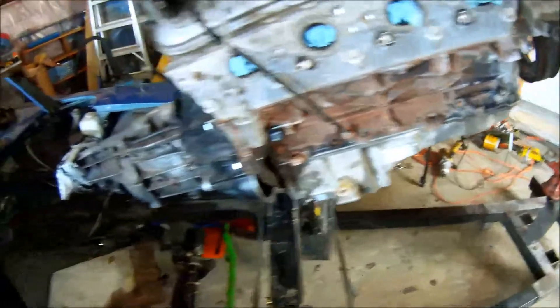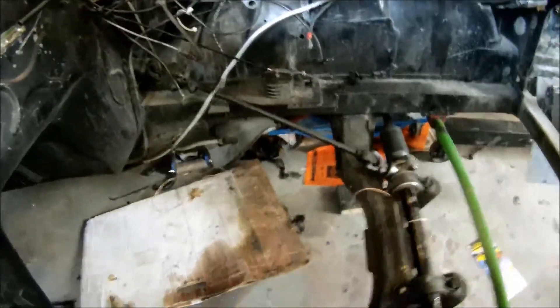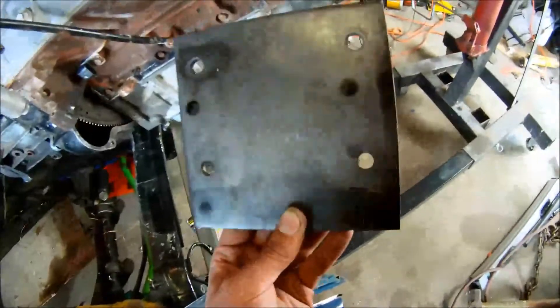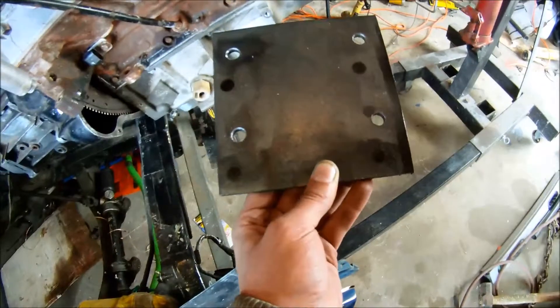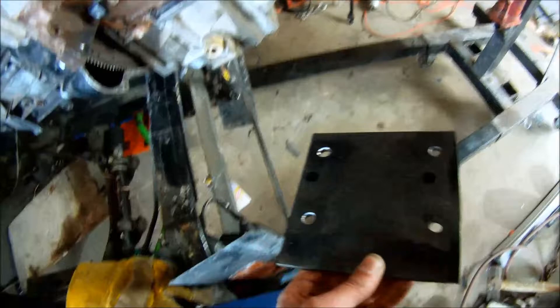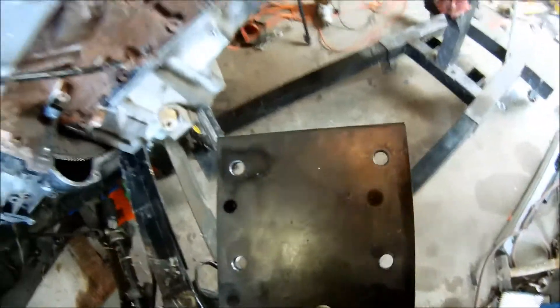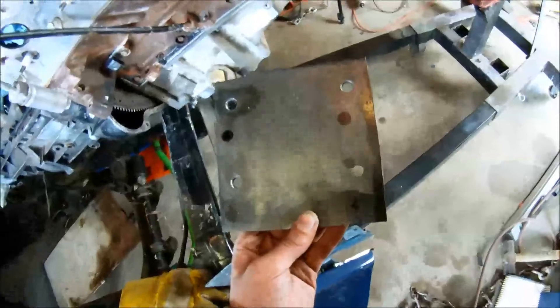After taking a look at all that, I found out that my passenger side motor mount down here actually sits a little farther forward than my driver side mount on the other side. So in order to make this plate work, I'm actually going to have to re-drill holes on the motor mount plate for the passenger side of the engine, just shifting the plate up and forward as far as possible. Should be able to get enough bite on the pipe then that we can get it to sit square on the motor mount in the car, so I'm going to go ahead and re-drill this.